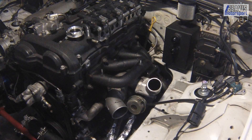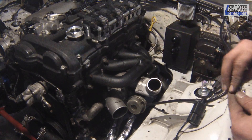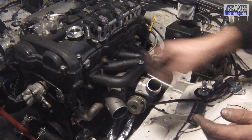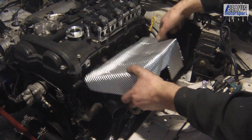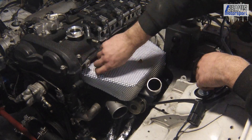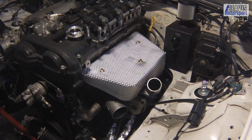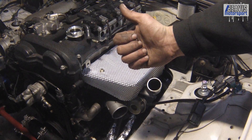With the manifold back on the car, it's time to install this heat shield for a final time. However, I made one slight modification — I added these little posts and some big fat washers as a kind of spacer to prevent the heat shield from really deforming down into the manifold, and to keep that space between the manifold and the heat shield, which allows for the air layer, which of course prevents the heat from getting through to the other side of the heat shield. And with that final nut in place, job done. I have to say, I think it looks pretty awesome.